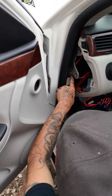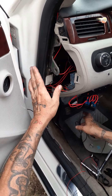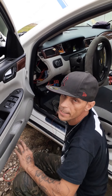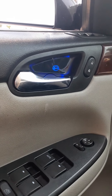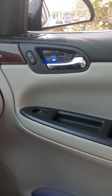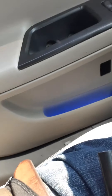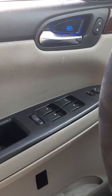This is how you do it with the tester and the on and off with your ignition. You have the power, and if it's off when you turn the ignition off and it doesn't light up, that's the one you want. Come back here and splice the end — that'll be your power. Take the black wire, run it through here, get your negative — there's your ground right there. Or if you want to run it straight to your battery, same thing applies: run to the positive and negative. Put it in with your ground right there, your power to the switch where you'll splice it in. Ground out right here and voila — turn it back on and you should be good.